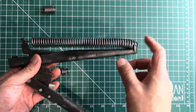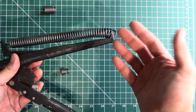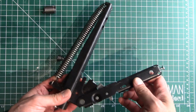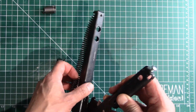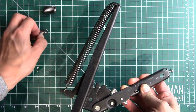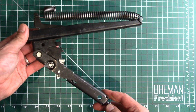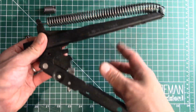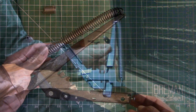And again, I'm not really advocating modifying springs like this because I was just cutting it off with a Dremel cutoff disc. But the only reason I feel okay about this is because, as you saw, this whole hinge, this spring, is inside the oven. It's completely enclosed. So even if this thing fails and snaps or loosens, it's just gonna break inside the oven, so it's got no chance of hurting anything. So that's the only reason I'm making this little DIY modification. But anyway, this seems pretty good. Why don't we go ahead and see if we can get this thing back installed in the oven?